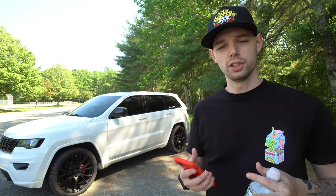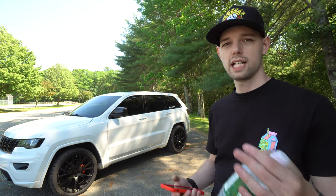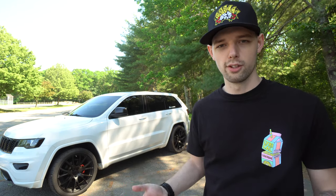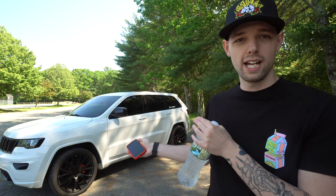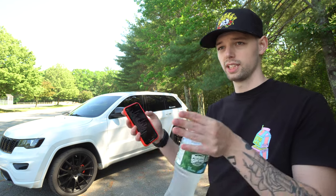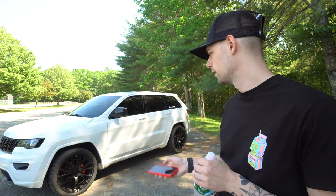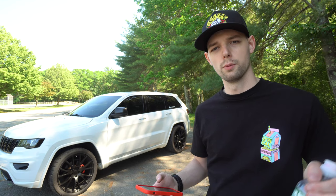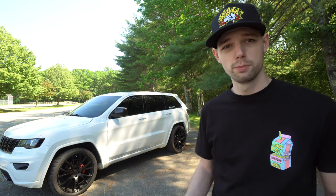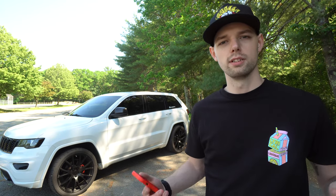So I ended up doing the wheels and tires — all within about one week. I went with 22 by 9.5 Hellcat replicas. The offset is positive 35 — everyone I've looked at with Hellcat replicas on a Jeep platform has been positive 30 or positive 35. They're wrapped in Nitto 420V tires in a 285/35 R22. I was super stoked because the Altitude came with 20s, and going to 22s fills it up more and gives it a sportier look, which it absolutely did.